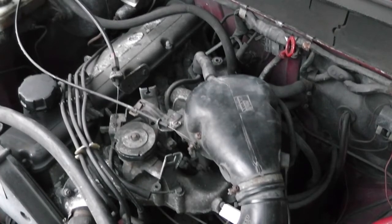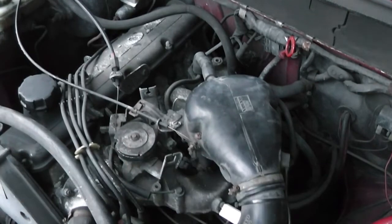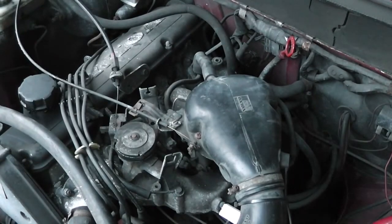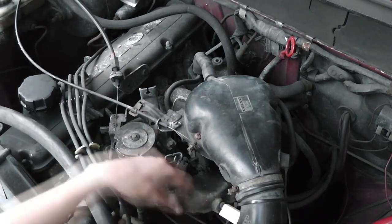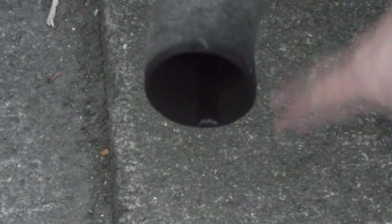I think the carburettor was in the right position there. It's not actually going to stop now, but I did cause it to stop by messing with it. So that's all it was all along. Another symptom was unburnt fuel and crap actually coming through the exhaust pipe — there was a lot of it, and although it's evaporated because it's petrol, you can still see a kind of greasy residue. There was a noticeably large amount of fuel not being burned, which told me the mixture was way off.